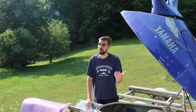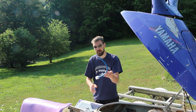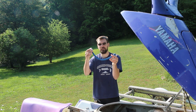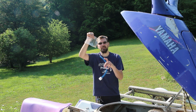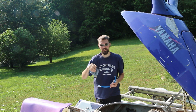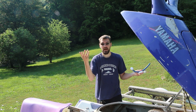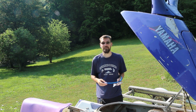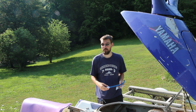These didn't come with any sort of flush fitting from the factory, which means we have to add one. The kits aren't expensive, and they aren't difficult to install. Basically, in your kit you're going to get a short section of hose with a garden hose adapter on one end, and this little brass fitting with a hose clamp. There's a screw that we can remove from the exhaust, place this brass fitting into with our hose, and then we have a ready-to-go flush fitting — either for flushing out salt water or flushing antifreeze through to get rid of any fresh water or salt water.